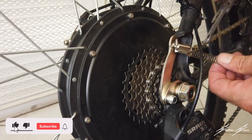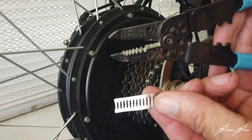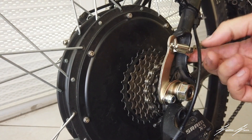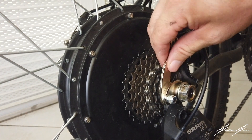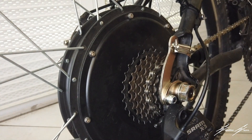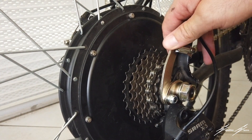I'm going to use a pair of clippers to shorten this and clip it right off. Make sure to leave some of the metal so you can re-hook it if you ever need to take off your tire. And there we go — the torque arm is secure, the bike wheel is bolted back on, and we've got an extra safety precaution on the DIY e-bike.